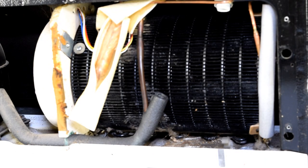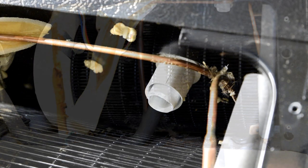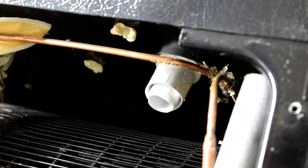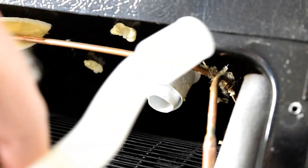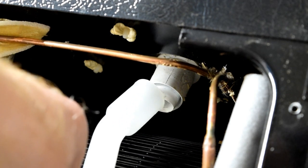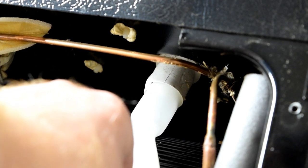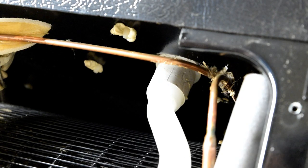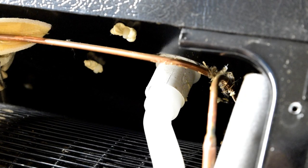Let me get a better angle so you can see the reinstall. I wanted to show you the nub that the defrost drain line plugs into — this is pointed towards the ground from the inside of the cabinet. To reinstall, just reverse order. Then clip the bottom of the defrost drain line into the clip on the bottom of the cabinet.